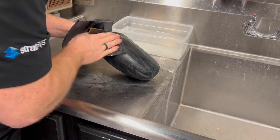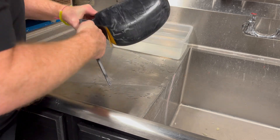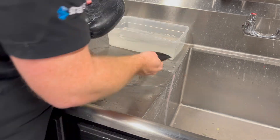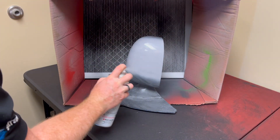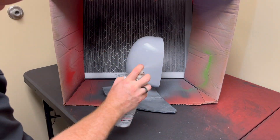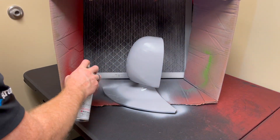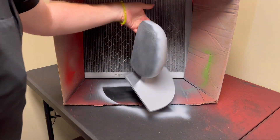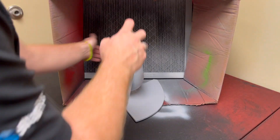Next is wet sanding. I'm starting with a 600 grit wet sandpaper before moving on to priming. Using an automotive filler primer, we will additionally fill in any of those bumps left behind from sanding. It's always better to use multiple coats than to get it too thick and have runs or drips, so take your time and be prepared to do several coats.